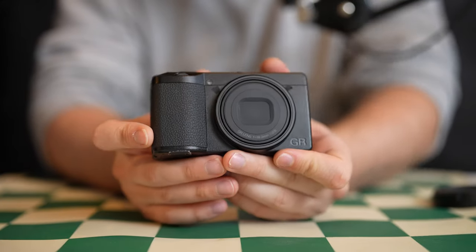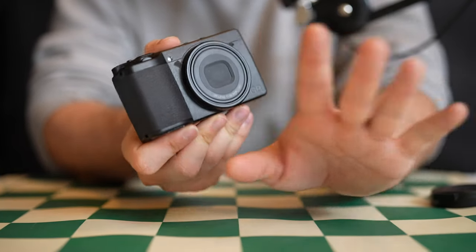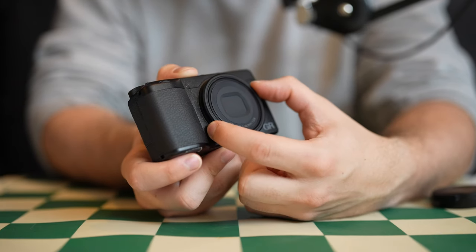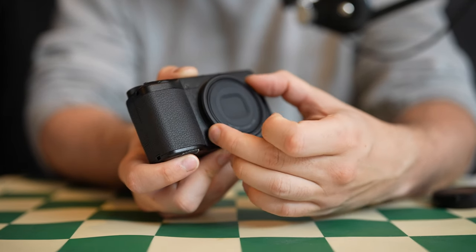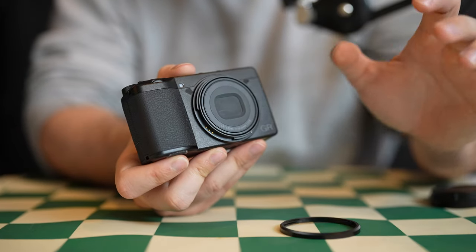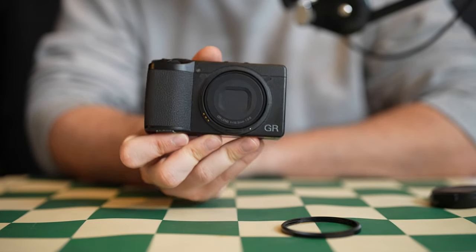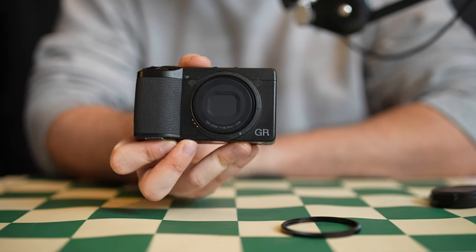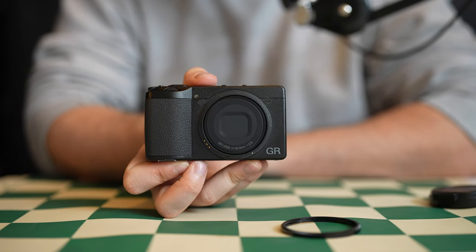So how does the Sensei Lens Protector for the Ricoh GR3 work? First, you're going to have to make a modification to your existing camera, but don't worry, it's not a complicated one. You're going to take this ring and remove it with a small turn in a counterclockwise motion. Don't worry about breaking it — it's going to come off. A couple more rotations and now it's out of its groove, and it will just pull away. Put that down and don't lose it. Now the ring has left the outermost edge of the lens area exposed, and there are actually some contacts on this camera for the wide-angle adapter which Ricoh sells, but we're not using it for that. We're going to try our best not to even touch those contacts.